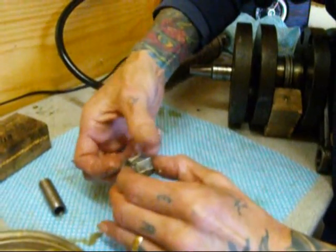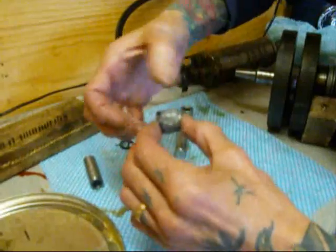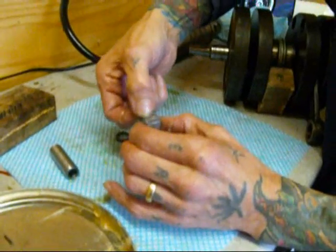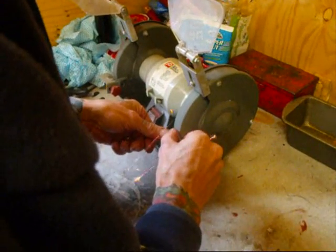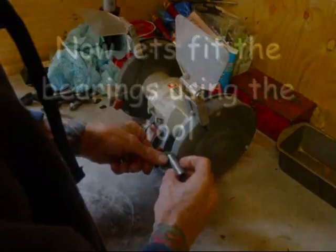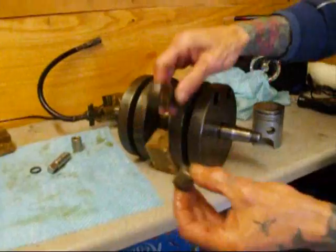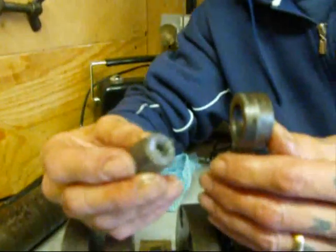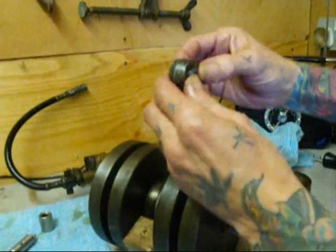And just spread them out, because we know there's 28 of them. There's 28 of those loose rollers that go on. A few more there. Two there. That's it. So that now, which is assembled on the tool, we don't want to put the other spacer on yet. See, the grease does do the trick. It's holding it together. You'd never do that without grease. Right, so now straight in there, and then you put the other spacer on like that.